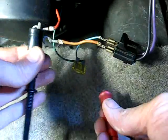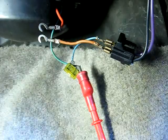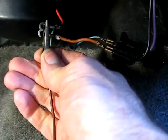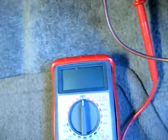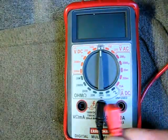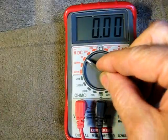Remove the positive and the negative from the amperage setup. Click the positive to this wire right here, and take the negative of the multimeter and put that to a ground. Then take these two wires and clip them together. Now take your multimeter and move it from the 10 amp max back over to the voltage pin, and move the dial to DC voltage, 20 on our scale.